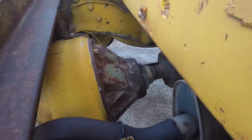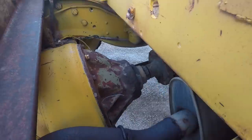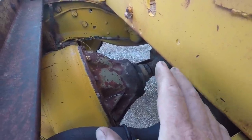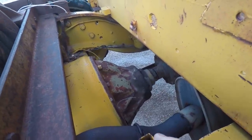Big old pumpkin rear axle. This one actually had the axle break on the previous owner — it broke the axle and they pulled out the center section and replaced it. I had the old center section and the axles came with it. It's kind of like a 9-inch Ford, just bigger.